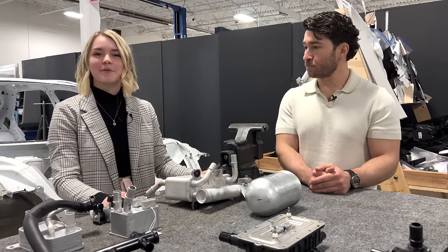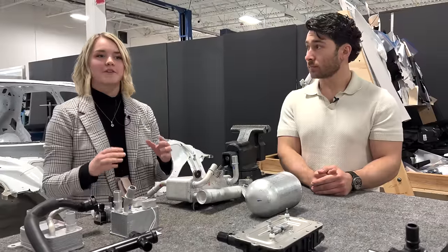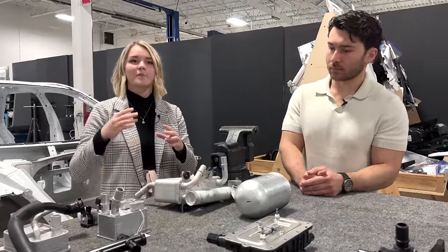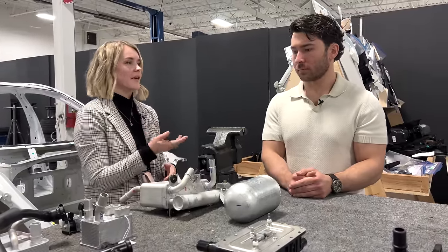It's not something that I've seen before, and it definitely is very thorough in terms of making sure that your refrigerant is in as pure of a form as possible before it enters the compressor and heats up to be a part of that system. Because as soon as it goes into the compressor, it goes into the AC condenser.